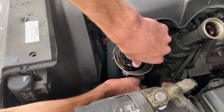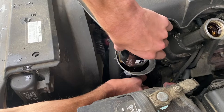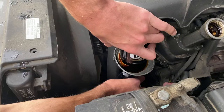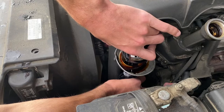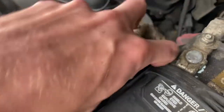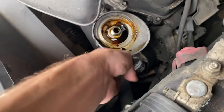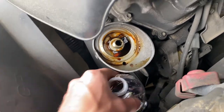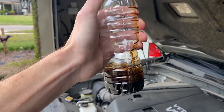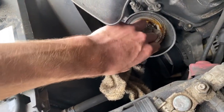If you have already drained the oil it shouldn't be too much leaking out, but you're going to need to put the bottle there so you don't make a mess. A lot comes out when you take it off the threads — as long as you have the bottle in there it should just flow right into it. Once it's pretty dry, take a rag and wipe up all the excess oil that doesn't drain out and then you're ready for your new filter. The water bottle has caught all the oil that was flowing out, which really saves you cleanup time and prevents a mess.